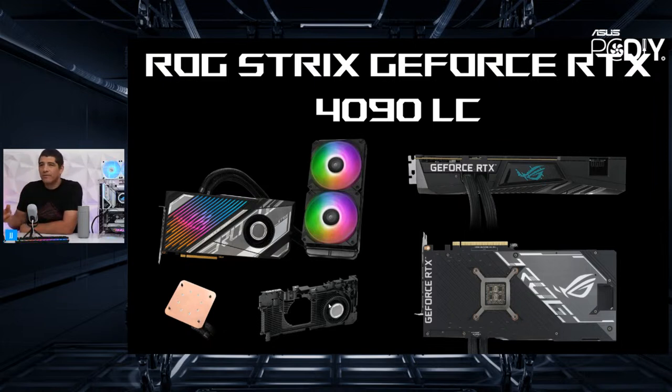That along with the factory overclock are two additional ways that you get a bump up in performance. So the higher TGP, the higher clock speed, and then the high-end cooling performance helps to keep the high clock speeds consistent. Those are the three ways that you get that boosted level of performance with the card, along with, of course, very good temperature performance for this model, okay?